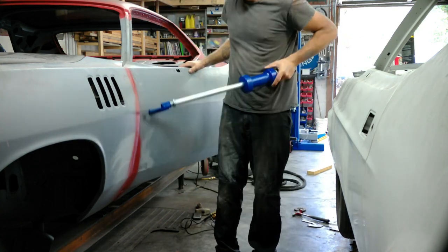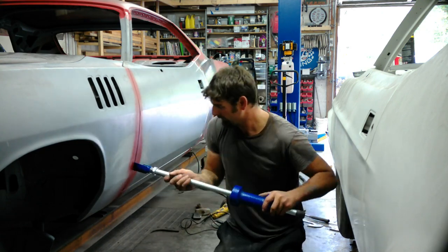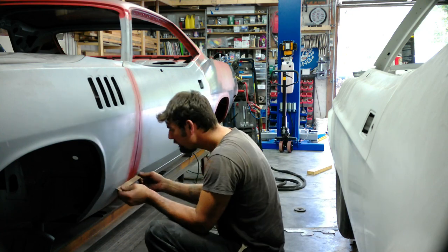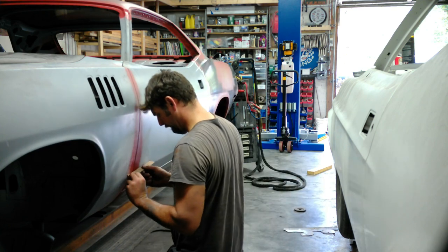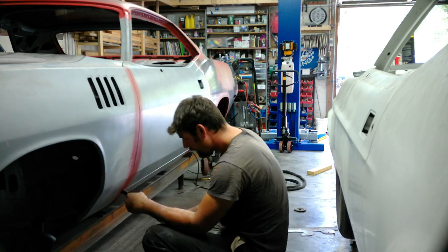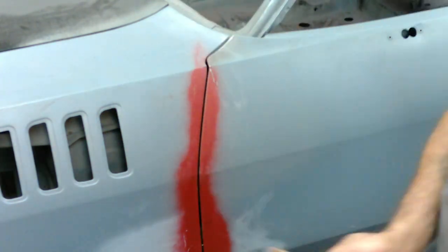Try not to go crazy — just do a little bit at a time. You don't want to over-stretch this metal, it takes a little finesse. I'm not pulling hard on the slide hammer even though it is an 11-pound slide hammer. After every couple hits I go ahead and check exactly what I'm doing, and if I go a little too far I just take the body hammer and readjust. You don't want to put any dents in this — it's kind of like using heat to shrink metal: if you overdo it, it makes it a hundred times worse. I also decided to open up this gap a little bit since it was too tight on top, so we took the flap disc and cut it down.